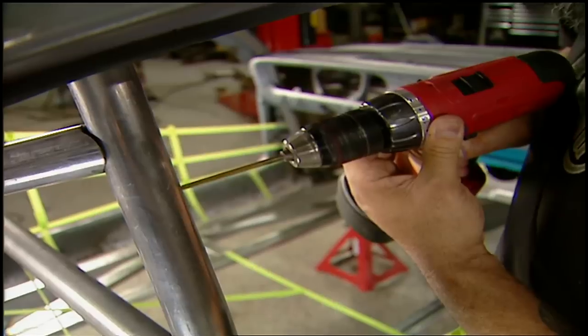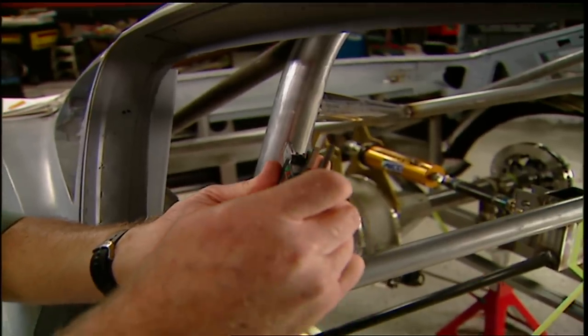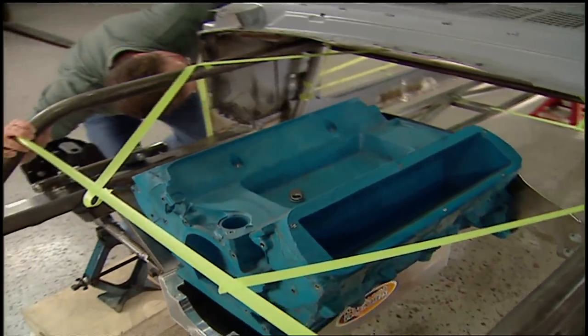Without the proper stock, there'd be no reason to continue. I learned we need three permanent holes for random checks of wall thickness. The previous measurement was 1.66, we've got roughly 1.51 — that's .15 difference. All that's required is .12, so I'm in there. You're good to go. That was easy, but I'm still crossing my fingers.